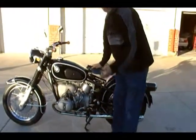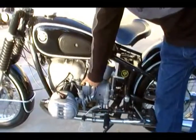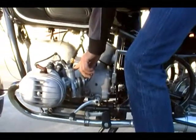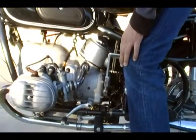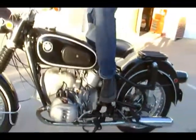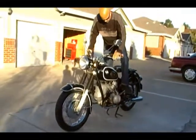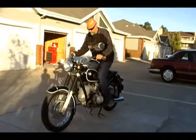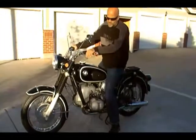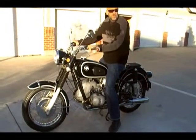For the fuel, I just wait until you can see the fuel going through the fuel filters. Then there are two ticklers, one on each side — just press them down two or three times. You've got a decent battery. Like I said, there's no choke, so you have to let it warm up before it'll idle on its own. I'll drive around the block here quick.